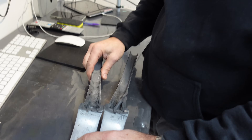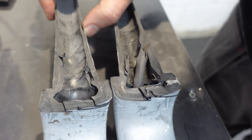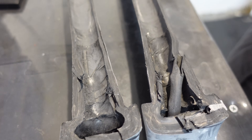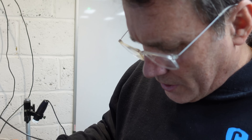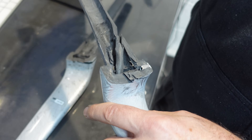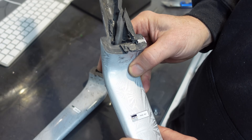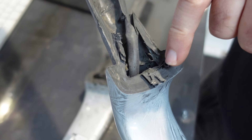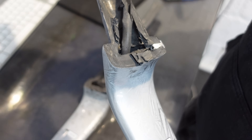These are the forks — very nice, responsible depth to these — and there's a little bit of delamination. I can only assume it must be part of the cutting process, but it shouldn't really delaminate like that. It would still take some effort, so I wouldn't worry too much. It's interesting to see the steerers — they've employed basically the same process as the latest modern western bikes with a molded all-in steerer. The old ones used to be rolled up like a toilet roll, very tight and thick material, inserted into the fork crown area with a collar of aluminium bonded in. Now you can see the hairs running all the way around — bikes have been doing this for just a few years and they seem to be fine, with nice solid material.